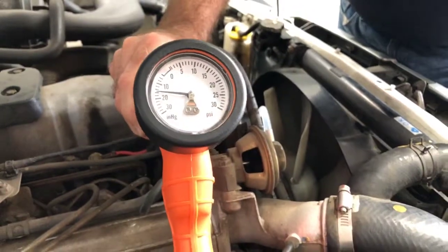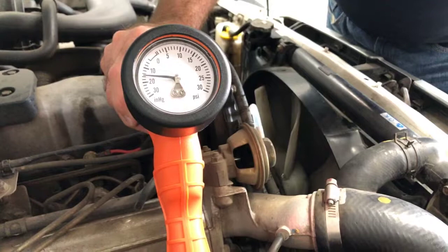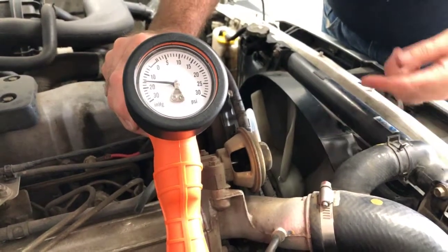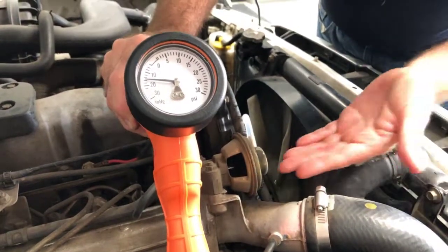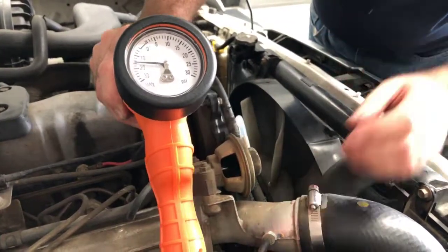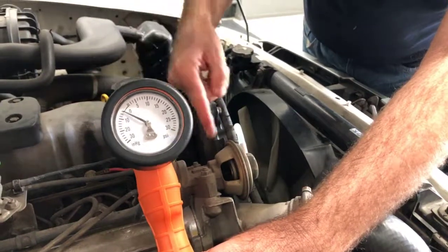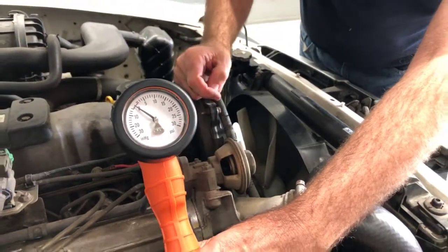You can also see now that we're holding a steady vacuum, and that there are no leaks either in the diaphragm or in the system we're testing. I'll move this back now to the pressure setting and you'll see it leak back and see the movement of the actuator.